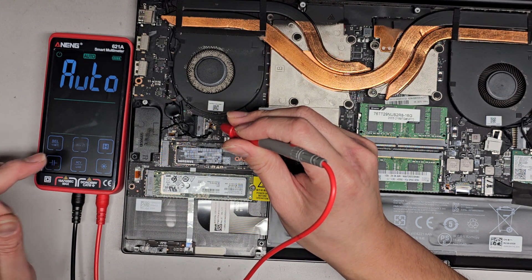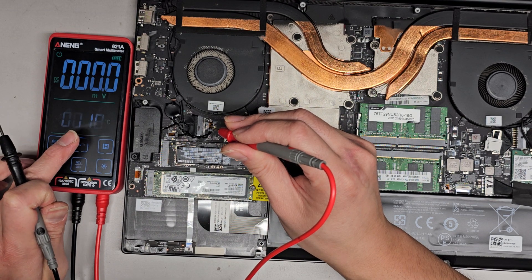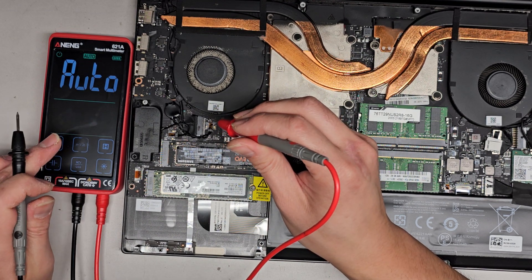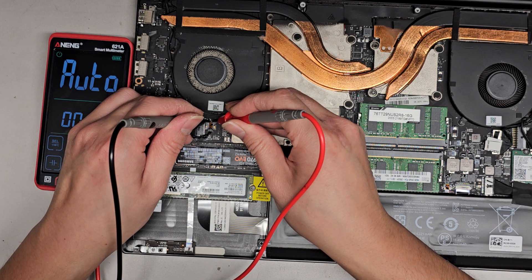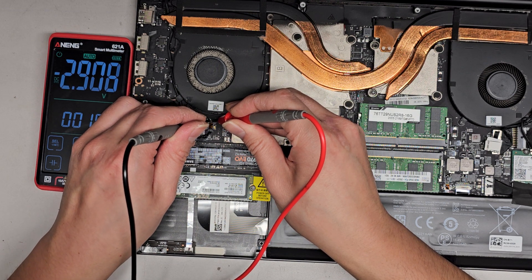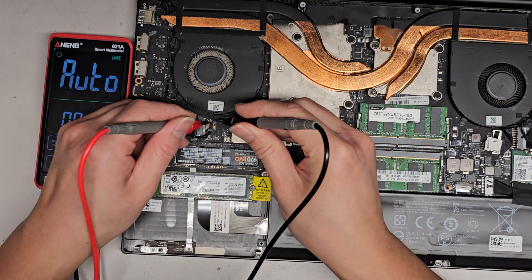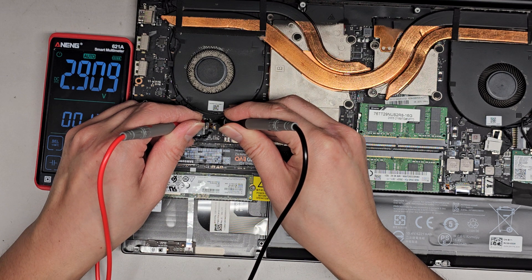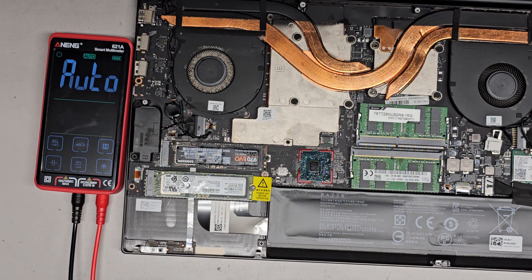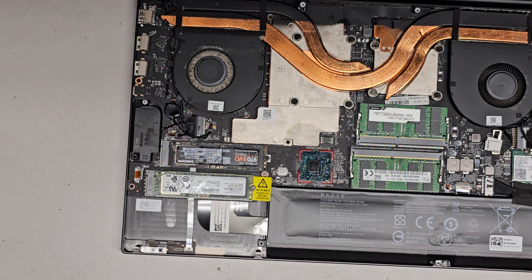This thing doesn't have a way for me to change the millivoltage to voltage — it only has the auto settings. There you go. The positive is on the left side, because if I switch it around it shows negative. You can see it's less than three volts, which usually means it's probably going to need to be replaced soon.